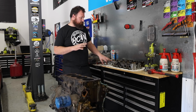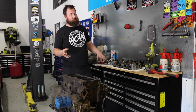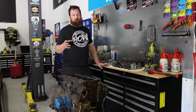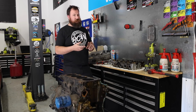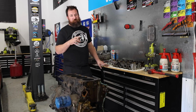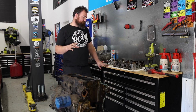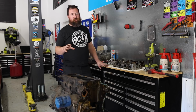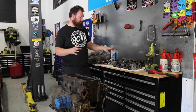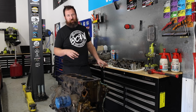But now that we've got to where we're at, we're going to pull out all the new stuff that I've already bought for this setup, run through it all together, and work out, as I said before, what parts we need to buy. I know obviously we need the cam, the valve springs and a VRS kit. The timing kit, I believe, comes with a timing case gasket, so we may also just need a sump gasket. I wasn't sure if this engine was going to use an actual sump gasket or if it just had grey sealer. So we'll pack this area away, get all the new stuff out, have a bit of a look at it and froth over the goodness.